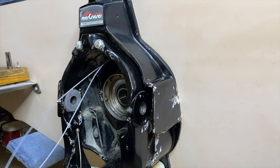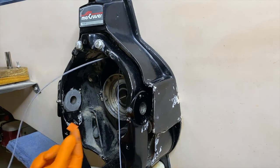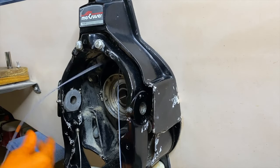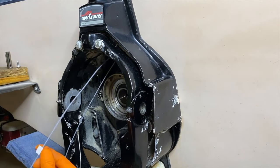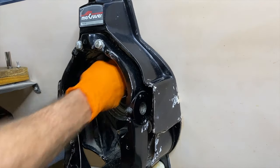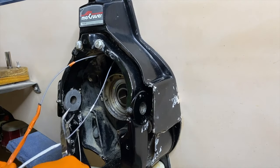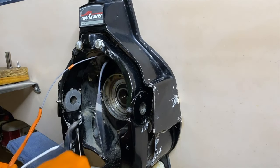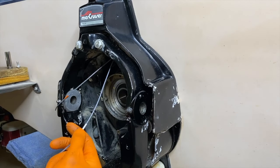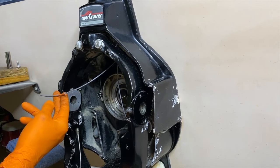I cut small half-inch pieces of orange and white electrical tape to add to the port side trimmer cable and the trim sender switch wiring respectively — white for trim sender, orange for trim limit. I am now going to cut these away. From here I'm still organized: white for trim sender or starboard side, orange for trim limit or port side. I'll go grab the new wiring and tape it to this end of the trimmer wire.